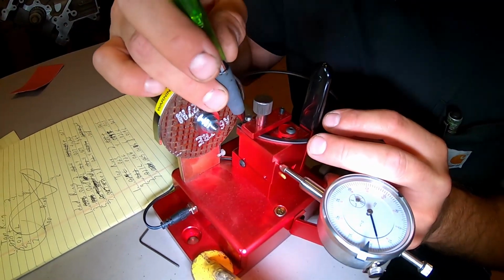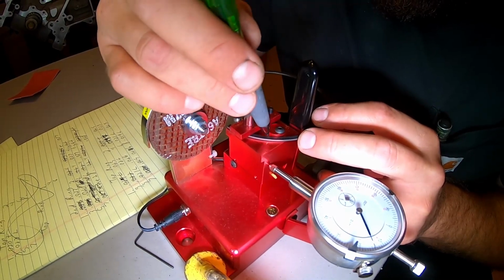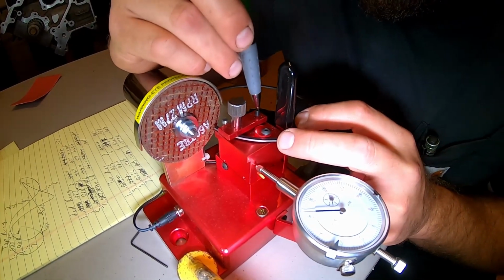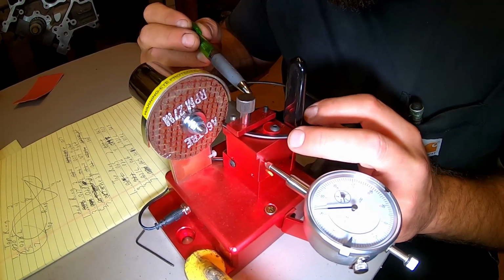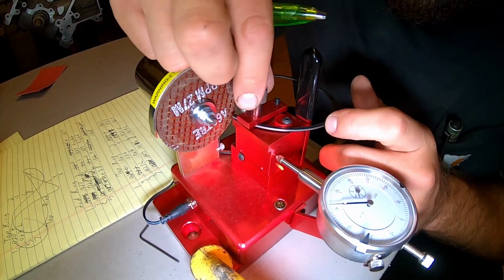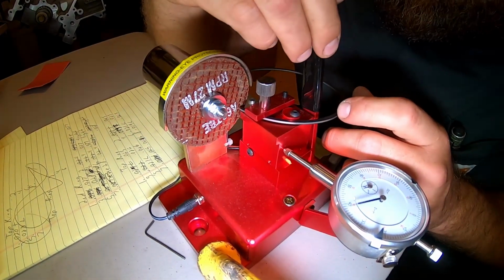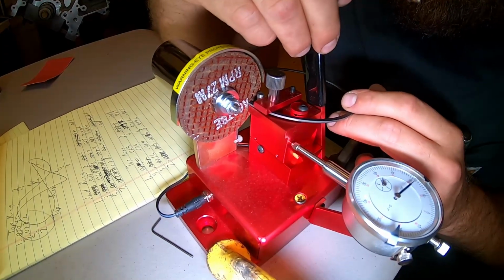Get the ring to ride all the way against this pin here and all the way here. Like I said, that's where you're going to adjust how big your ring is. Another big thing that we have found, this set screw right here is very important. Whenever we got it, it was really high, so for a thicker ring, and whenever we'd go to tighten it down here, it was only clamping down on this very edge of the ring. So whenever we were going to grind on this thing, the ring was actually moving just a touch.